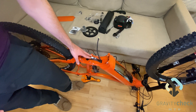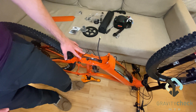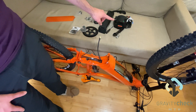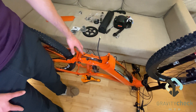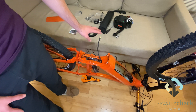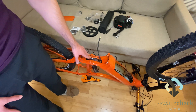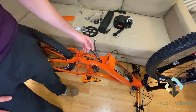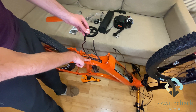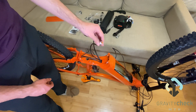Do not force the motor down on top of the wires. You're going to have to move the wires around and massage them to get the motor to go all the way down where you need it. One thing that can help is drilling out the mounts where the motor mounts to — the pins are very precise, and if you open those up a little bit it'll give you more leeway. If you try to force the motor down you can break these connectors, or like I did, actually cut some of the wires by pinching them between the mounting surface and the motor.